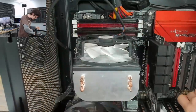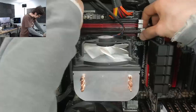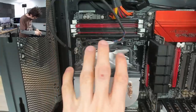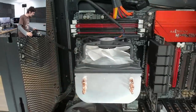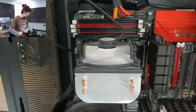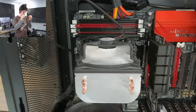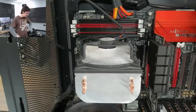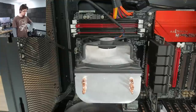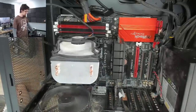So all we've got is front panel headers. I'm going to move the memory back to slot one as well — fairly certain we want to be in slot two and four counting back from the CPU, but we'll try somewhere else just to fish for a different reaction. A million beeps, then it power cycled. And then we're back to six beeps and power cycle.